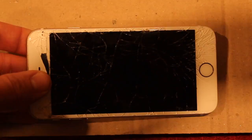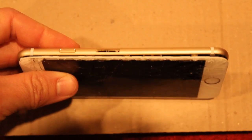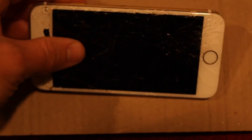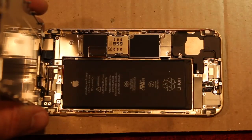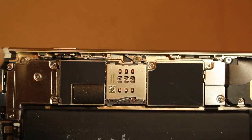There's one in the SIM card slot. It is in the opposite location compared to the iPhone 5 and 5s. It's hard to see but it's right at the tip in there. When you take out the SIM card, it's white, and if it's red, it's water damaged. Right there — you can see it pretty well.